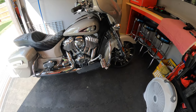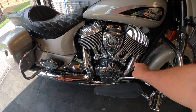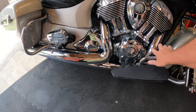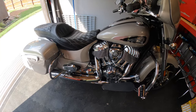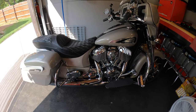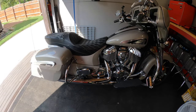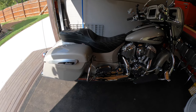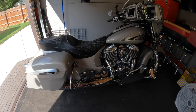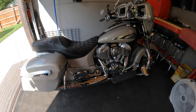After lots of cursing and screaming and yelling and almost pitching a childish fit, I finally got it finished. It wasn't really that bad — except for this one piece and having to take that off, that was the hardest part. I need to go back through and wipe everything down. If you do something like this and remove your heat shields, make sure you wipe all of your skin oil off — otherwise you'll have discolored heat places. It'll burn the finish. So I've wiped it down already but I'm going to do it again just to be safe.